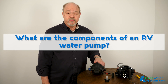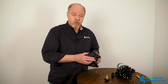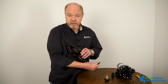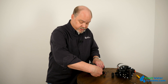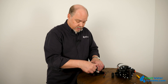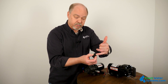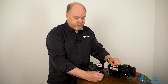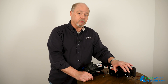What are the components of an RV pump? An RV pump component list is pretty short: the pump itself, the fittings it's going to require to hook up to your RV's water system, and the wires to hook it up to the 12-volt electrical part of your RV system. The fittings can come either as a threaded type unit — this one attaches with wing nuts and can be a barb, either a straight or an elbow. This other one uses a fitting called a quad port, which works by having a couple of O-rings on the bottom of the fitting, and they literally plug into the pump and lock in place. The quad ports are also available in a variety of threading types or even barbs, elbows, or straights.